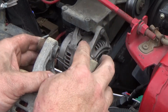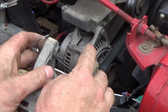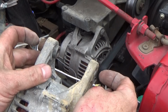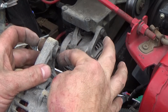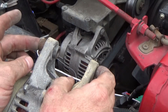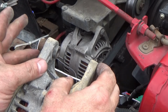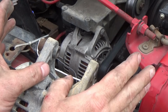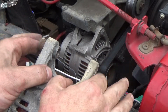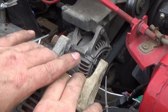But also, whenever you go to loosen the alternator, like what I'm showing you here, just to change your serpentine belt, you want to loosen the nut enough that this isn't creating friction against that bracket. You don't need to take the nut off, but what I suggest is having the nut loosened up so you've got about a 1/8 inch, 1/4 inch gap back here. Therefore you ensure that you've got plenty of room for this bushing to relax and allow the alternator to pivot like we need it to.